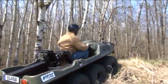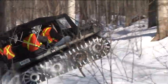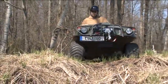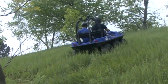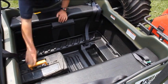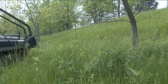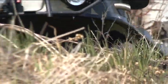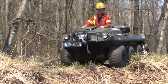Many times hills are overgrown with vegetation, hiding gravel, rocks, washouts, or fallen trees. The ground can consist of dry soil, moist or wet clay, snow, or terrain unfamiliar to the operator. Hill climbing and descending can pose a challenge to any driver; it is always best to avoid steep hill climbs or descents if possible. When driving up a hill, ensure all cargo is secure and stowed on the floorboard in the rear compartment. Approach the hill head-on under controlled speed. Travel slowly up the hill. Avoid sudden acceleration or making turns on a hill, keeping the tires moving without spinning. Slow the vehicle slightly when cresting the hill to avoid slamming the front of the vehicle.